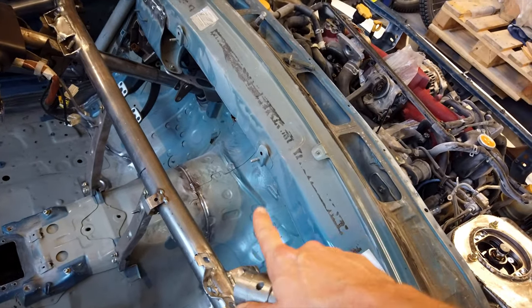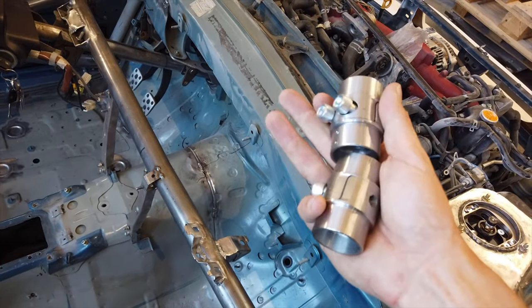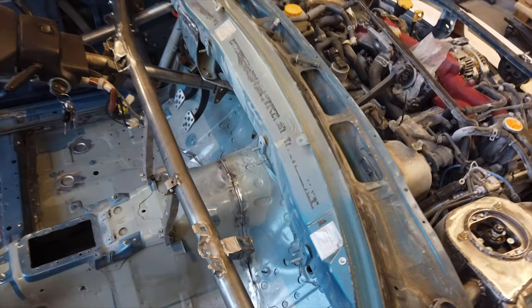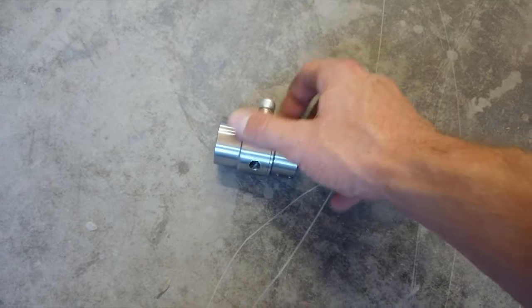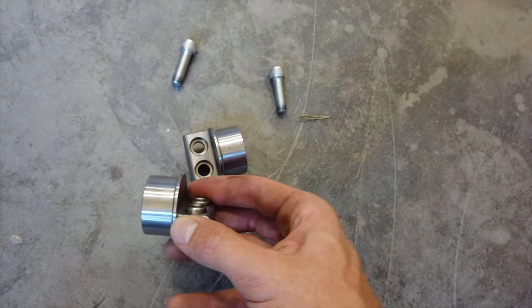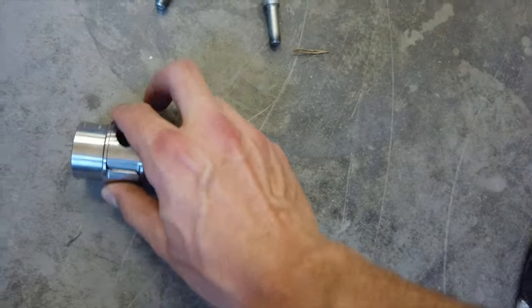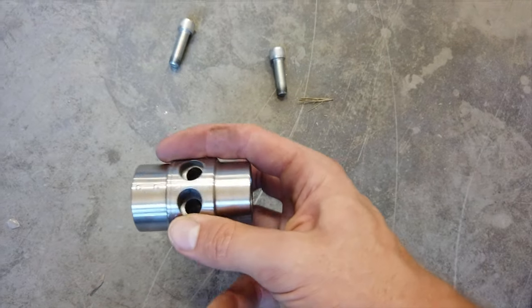We have this space right there which is quite tight, and that houses the heater box. It doesn't fit with the dash beam in there, so I need those couplers in order to remove the dash beam and install the heater box that comes behind it — and so I can remove it in case something breaks. Here's a closer look at the couplers themselves: two bolts hold the whole thing together. It's two halves that are basically identical, except one has little inserts that go right into the other piece. It locks together and doesn't wiggle at all — really secure, and apparently it's as strong as if you didn't cut the roll cage in the first place.